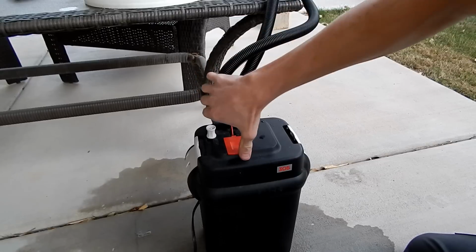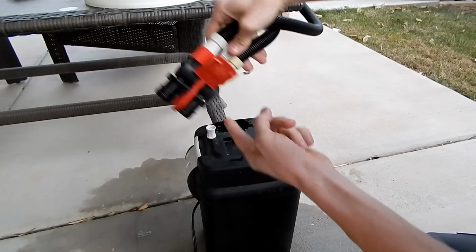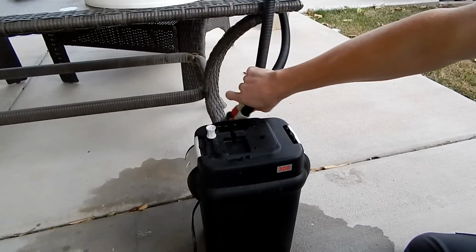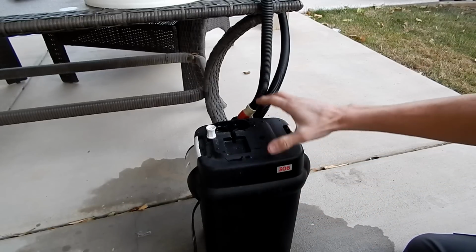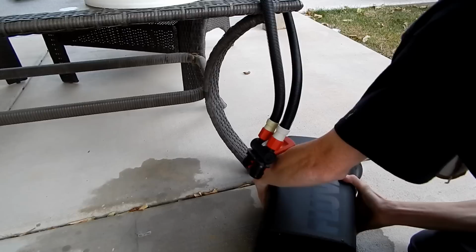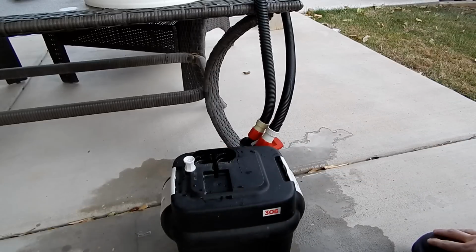So we're going to close off the aqua stop and we're going to open her up and make sure the aqua stop isn't leaking out of the side. Sure, it'll be wet on the bottom, but it shouldn't continue to release water that we're trying to get into the pump. Now the 306 is going to be tippy top full of water most times. So generally what I do is drain off some of the top, usually into my bathtub, and then I open it.